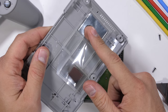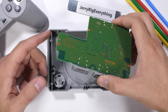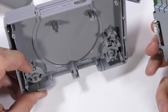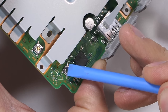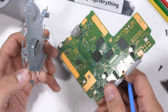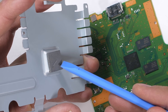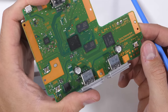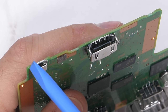The circuit board has four additional screws holding it in place. Removing those and pulling the computer guts out reveals the internal button structure — just plastic contraptions that reach down to the surface of the motherboard. The metal cover for the motherboard is lightly stuck into place with some thermal foam over the processor, sticky on both sides. We can now see the two USB controller ports, the rear HDMI, and the micro USB ports. Pretty simple design — PlayStation is definitely pulling some healthy profit margins off of this one.